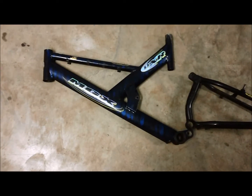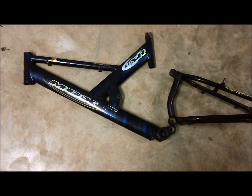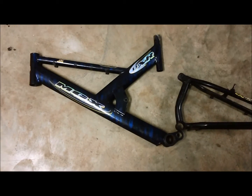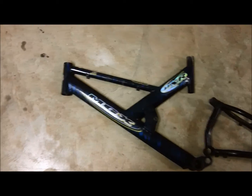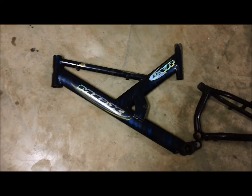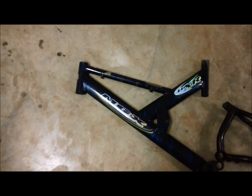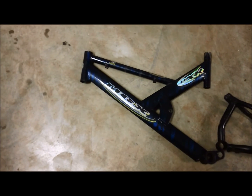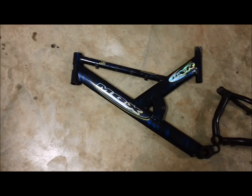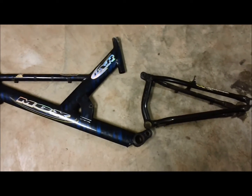They're like-new takeoff parts off of some of my other bikes that you've seen in videos. I will also try to keep it an economical build. This is going to be a rough idea for anybody out there who has a cheaper bike. I'll use parts that you can use, because for instance this bike has the 1-inch headset and came with the normal 1-inch threaded fork, and I'm going to focus on that because I'm going to convert it up. By that I mean it will be swapped to a 1-inch threadless, because both RST and Suntour still make some forks for 1-inch threadless. But this is just to give you an idea of what I'm starting with.